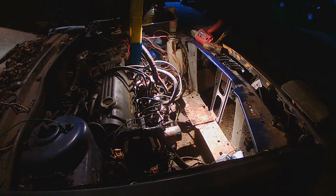And of course I got that Harbor Freight half-inch electric 120-volt impact, but it can't even move that bolt. The bolt that I'm looking at right now is the long one that goes through the front engine mount. And I'm pretty sure that somebody torched it at one point in time because it sort of melted itself into the rubber. And that didn't work very well because then it wouldn't come out and I couldn't get it out. So I just kind of left it alone and took the whole mount out, which took longer.